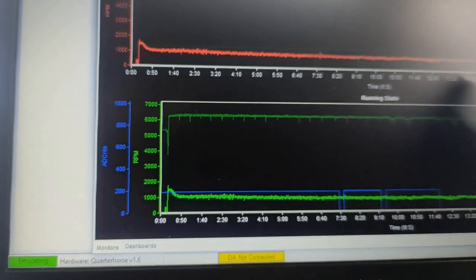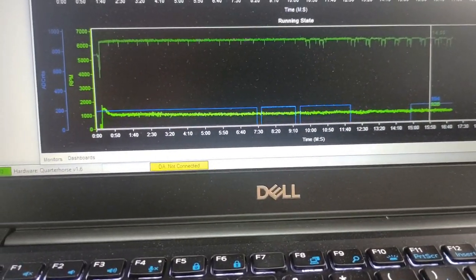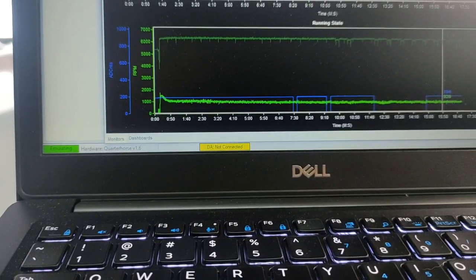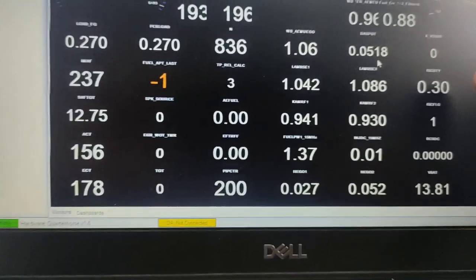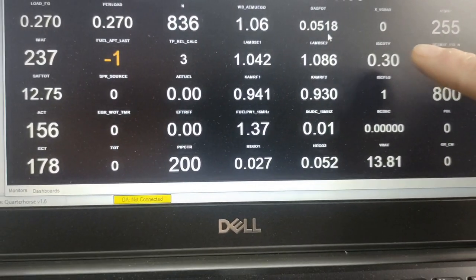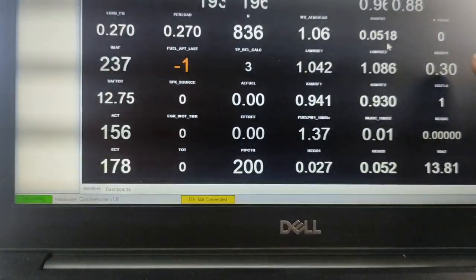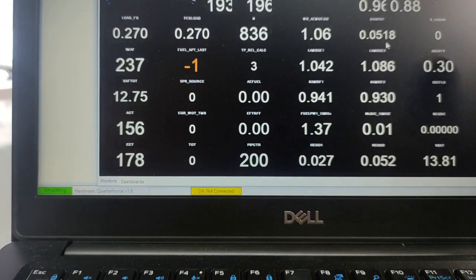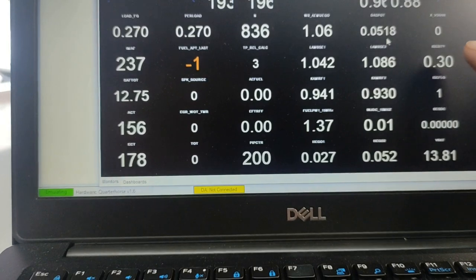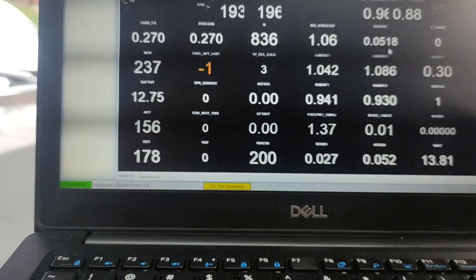This is the throttle position voltage on the green line — that's where I unplugged it to make throttle stop changes. This screen shows your idle control duty cycle. This was up around 50 before, and I'm trying to get it in the 35 range, so it was trial and error. It bounces around a little bit, kicks up when the fans come on. We definitely came down — we were hovering in the high 40s and 50s before I made those adjustments.